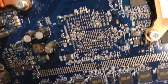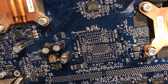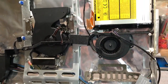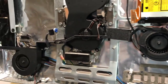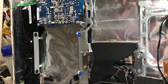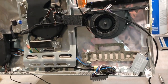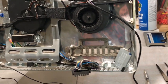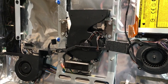We're going to take the heat sink off, give it a good cleaning, repaste it, and reassemble it. Then we'll go back and continue cleaning the inside of the case — clean those fans out real good, they were loaded up with dust. I'll pull the power supply loose to check it out and blast it with some air too. We'll take a paintbrush and dust everything off in there, then reassemble. Putting this thing back in is not going to be any fun since it was a real challenge to get out.